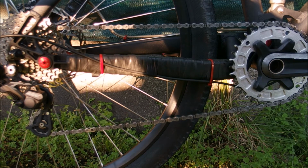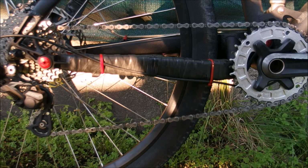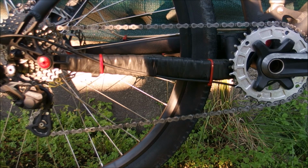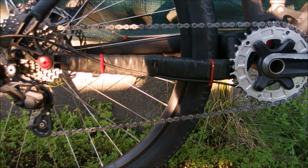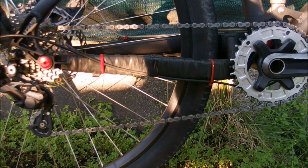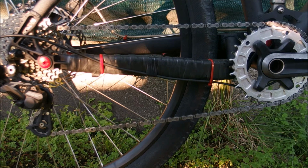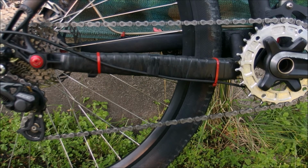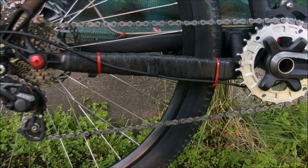However, when you're going downhill, you probably want to pedal a bit from time to time, and at the speeds you would probably downhill at, you want to have big on the front and something small on the back. Moreover, when mountain riding became more, let's just say, popular and more mature, mountain bikes started to lose chainrings, and the chainrings became smaller. So in order to actually ride downhill and have a good gear in 2010, you'd have to solve the problem of big ring and small cogs on the back without losing your chain.